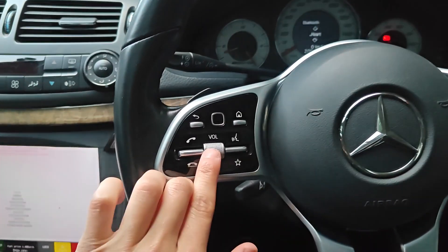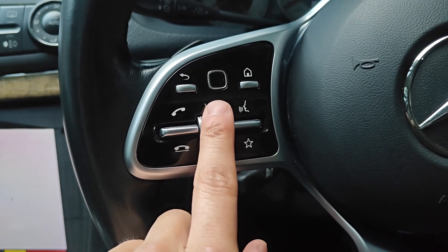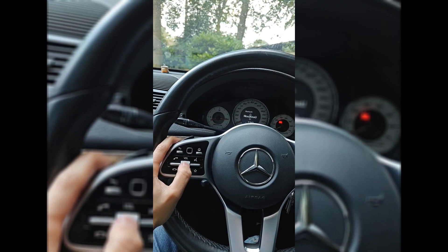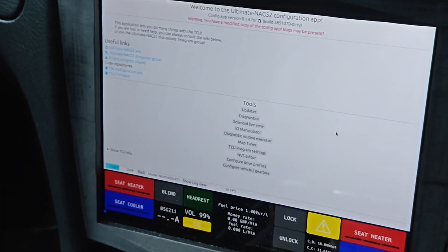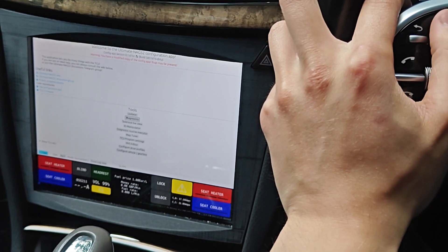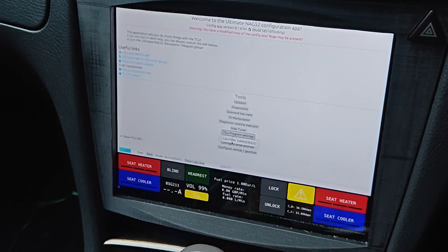So after all of that, we've finally got something worth talking about. The volume key works, so I can turn this up and you should be able to hear some music. My Bluetooth is disconnected at the moment, but that works. And now, if I press that, I can control the music and volume down as well. The main feature I've finally added is the ability to use this touch panel as a trackpad. If we zoom in on the monitor, you can see the mouse on screen is going with my movements. It works really well, though it is a little bit janky still — it needs some more motion smoothing, and especially cancelling when I press, because when I press my thumb wiggles and it thinks that's an input. But hey, I'm making my own touchpad driver.